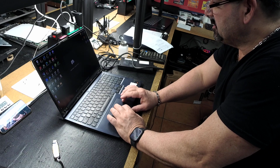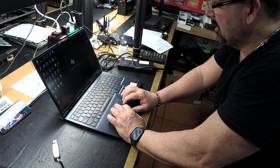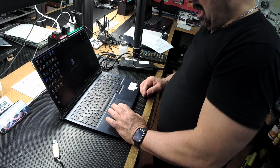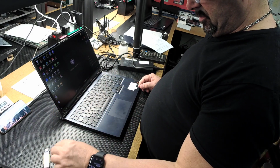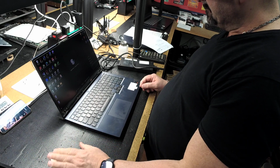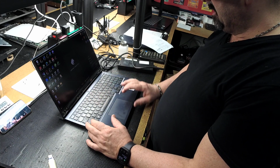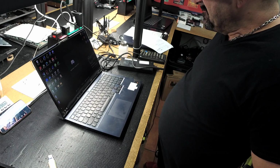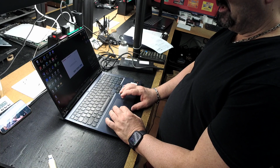Come on. So we're going to get online and I'm going to show you the website that I normally use. If you have access to the web, you could use this. On the Macs I didn't, because I didn't have the antenna on, so I just have red, green, blue, black, white images on that USB. But on this one, let's do the website. I believe it's lcdtech.info, but let's find it. Basically, just do a Google search for LCD test, and it's going to come up there on the first page.